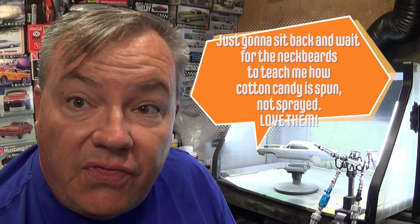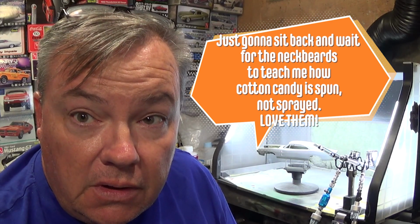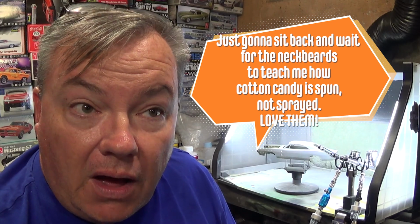Otherwise, I'll rattle can. But in airbrushing, one of the things you might come across with pre-thinned paint is spider webbing. What is really happening is you're making cotton candy. Cotton candy is made by forcing somewhat thick, sweetened and flavored syrup through an orifice with high pressure air, and that creates a web. So if you're experiencing that with an airbrush, your problem is your paint is too thick and your pressure is too high.